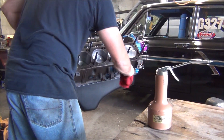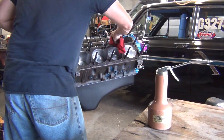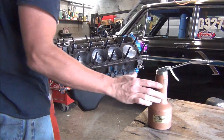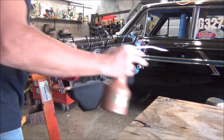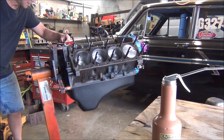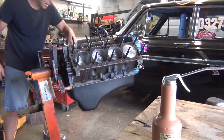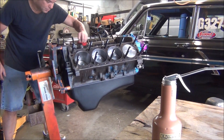I did take my hand and wipe the cylinder walls down one last time with some transmission fluid before we seal this thing up. I'm curious to see how this thing's going to run. There's some things I don't like about the cylinder walls — there's some scratches in there after we honed it. It's as good as we're going to get it honed. This engine's been together for a long time, and like I said earlier in this series of the rebuild, if I can get a season, maybe even two seasons out of it while I am racing, I can start putting together a fresh brand new short block.